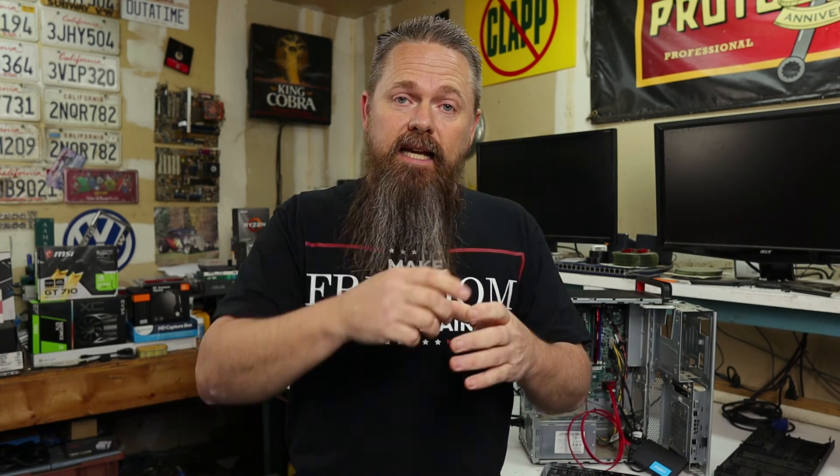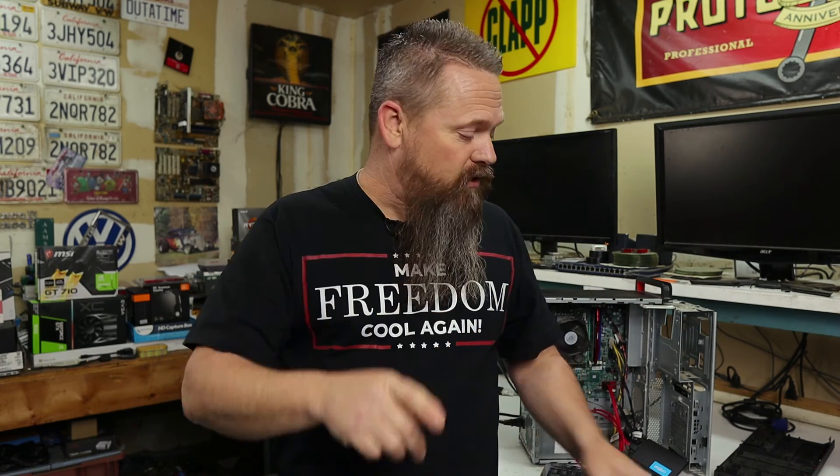Once the image is done, now it's time to actually mount the SSD into the case. Take the old three and a half inch drive out and mount the two and a half inch SSD in. Some cases already have provisions for the smaller hard drives, but if they don't you can get an adapter plate to adapt the two and a half inch to fit in a three and a half inch slot. The nice thing about an SSD is that unlike a traditional hard drive, it isn't susceptible to damage from vibrations. So you can be creative with your mounting — I've actually mounted them with zip ties before. It's not optimal, but in a pinch you can get by.